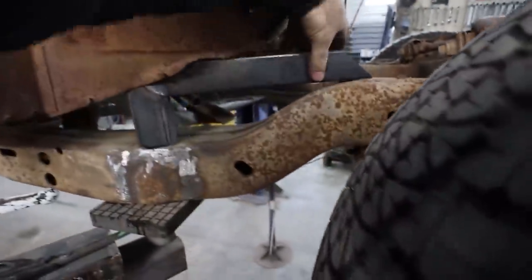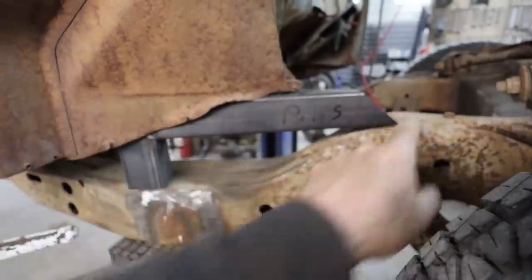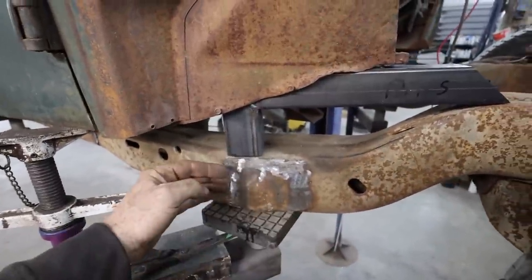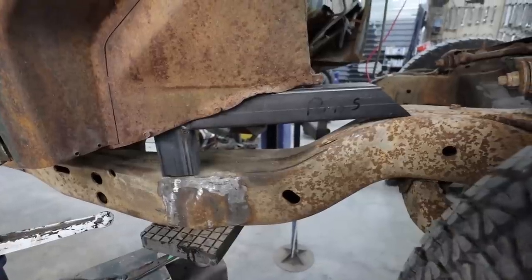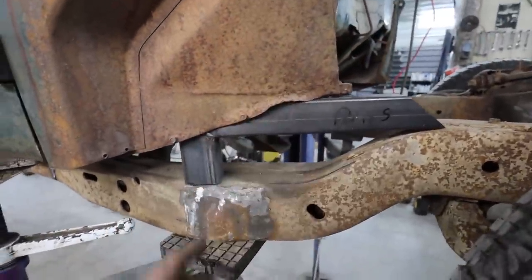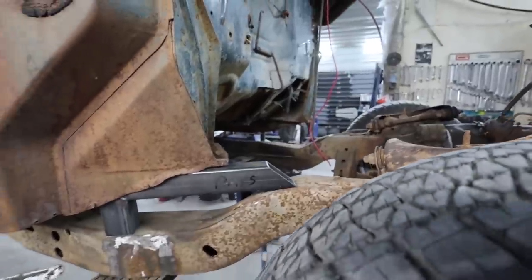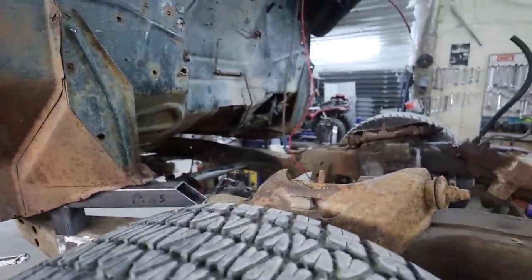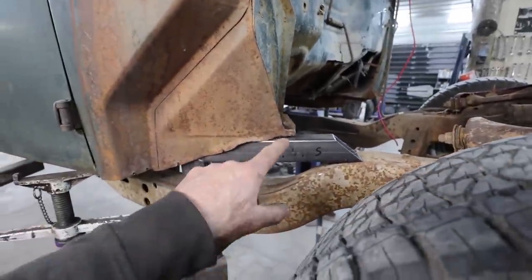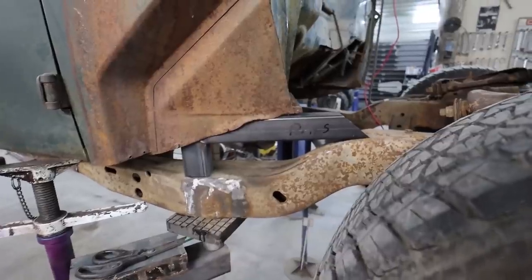And for the end game, it's still a little warm, but we're pretty much do a rubber mount in here. We're gonna burn this up down here. And then we'll do a gusset plate along here as well. Pretty much major overkill, but eh. We cut these other plates, so we may as well use them. We'll do something with it. I'll probably just come in on this angle or do something, but plenty strong for holding the cab on anyways. All right. Well, let's get a rubber mount into there, a bolt through it, clean this up a bit, and burn her in.